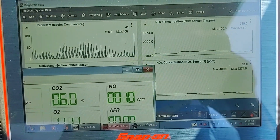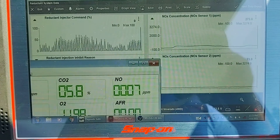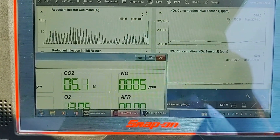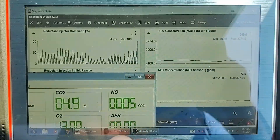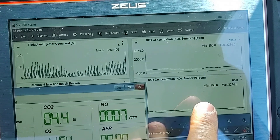Now there are a couple of other possibilities as to what could be wrong. It might have a partial SCR failure, or a little bit of DEF crystals — anything that would make extra ammonia out of the tailpipe that the sensor would see. But that's not the case, and I'll show you how you can tell.